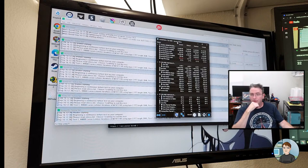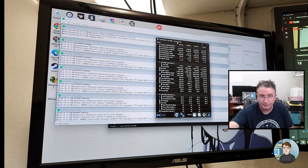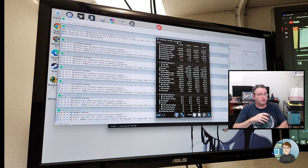Yep, low 30s is good for idle. I agree, Chris. Mm-hmm. Under 85 in Prime is decent. They should have spent the money on a good cooler. This cooler came with the computer. It's an iBuyPower pre-built computer. If it turned out they did need a new cooler, we could get them something for probably about $60 that would do a fine job with this processor. I think it's going to be okay, though.